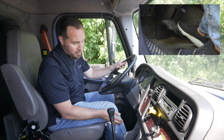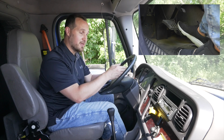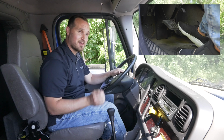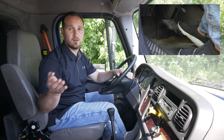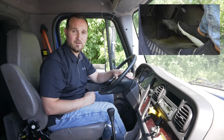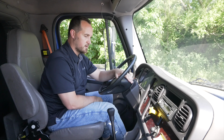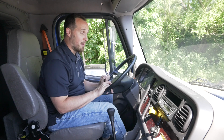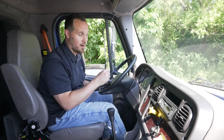I'll hold my service brake down with my foot for 1 minute. I should not lose more than 3 psi of air in 1 minute as I hold my service brake down. I will either count the minute or ask the examiner to do that for me. Once the minute is up, we will check if we lost that 3 psi of air. My minute is up. I counted a minute. I did not lose more than 3 psi of air.